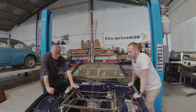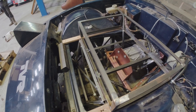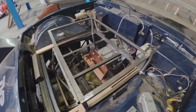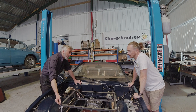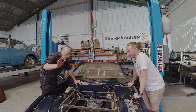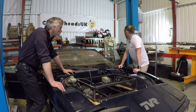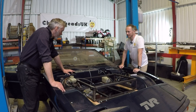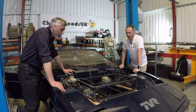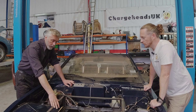That means we put everything into one box, which is quite neat. It clears nicely — we've got good clearance to the bonnet. One of the things we want to make sure is we always have about an inch of clearance between the battery box and the bonnet. So that if you do manage to mow over a pedestrian and they smack onto the bonnet, it won't immediately hit hard metal. I'm looking to rectify the dodgy air intakes on the bonnet because I don't want any of that sort of stuff on it.